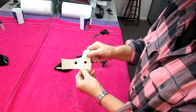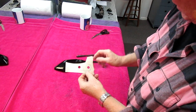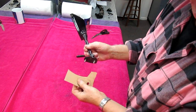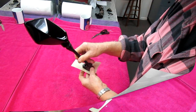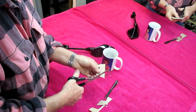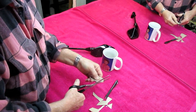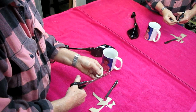That's basically the shape we need. I don't need the holes this big because I can put little bushings in the fairing. The holes I drill in the aluminum will be an exact match to this, and rather than having the parts attached to the mirror, I'll make up two little bushings on the lathe if I don't have any that fit. A lot of times in the past when I tried to skimp on the time it took to make the pattern, you save a few minutes and then you wind up over at the belt sander for an extra half hour. I'm trying not to be penny wise and pound foolish — the little bushings are the easiest way to deal with those oversized holes.